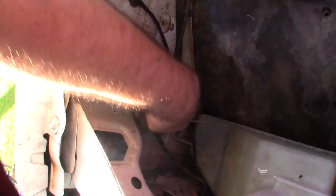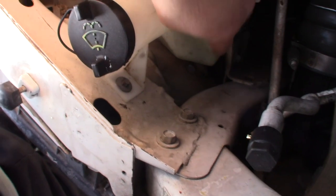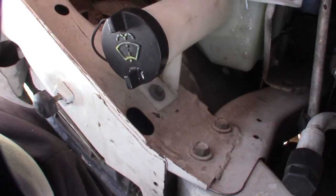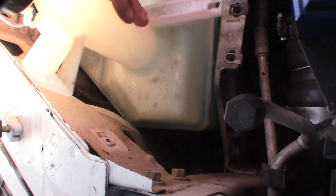You're going to take the battery tray off — that's 13 millimeter here and here. Now the battery tray is removed, so I can take the eight millimeter bolts off: one, two, three. The pump's in the front. You have to pull the pump up.